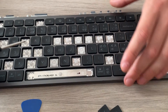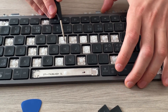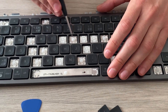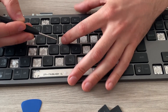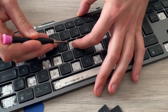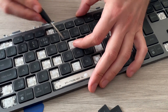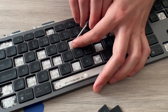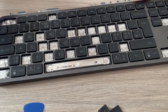You can also use a screwdriver to take out the plastic hinge. There are two legs that are closer together and two that are farther away. You just go to the top ones, try to push the hinge to the top, then slide the screwdriver underneath and take them off. The one on the left is already out — let's try the other side: just slide it underneath and pop it out.